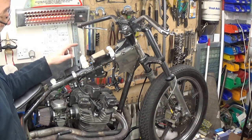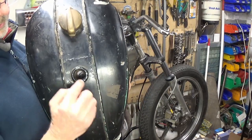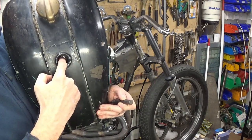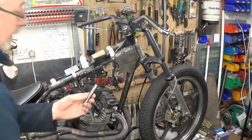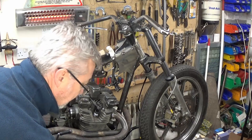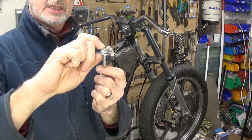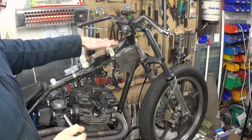The centre of the tank here is where the bolt hole is in the middle of the tank — you can see it there. So all I need to do there is put a post up there. I was going to put that post which actually fits through the inner hole in there, so it'll be sticking up past it. Then what I'll do is put these rubbers on until they're resting against the tank, up to the top of there. Then the bolt will go on because this will have to be tapped, and that will keep everything compressed down and the rubbers will be pushing the tank down.